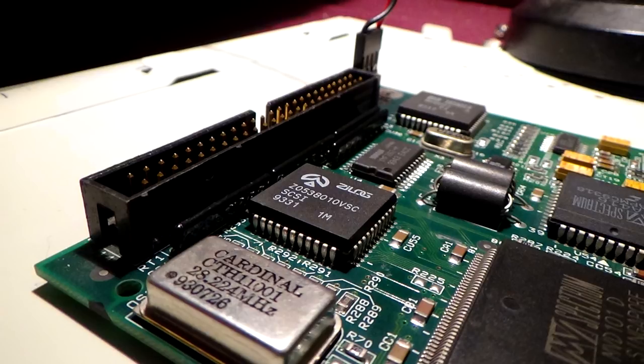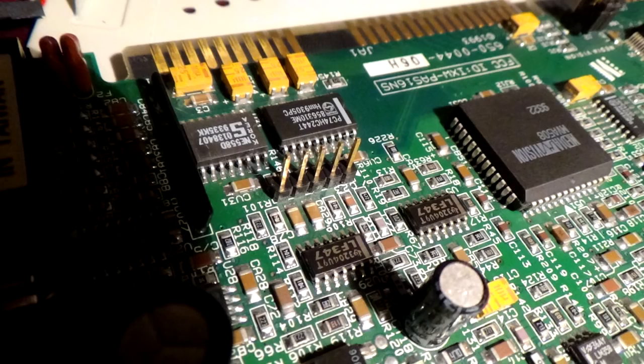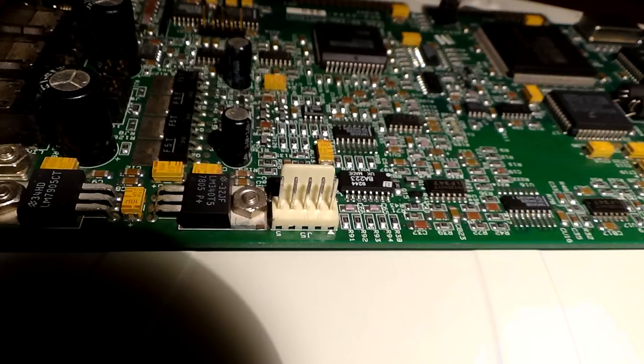One advantage to the SCSI interface is that you can actually plug in devices such as hard drives, and they'll work, you can use them, but you won't be able to boot from them as the card has no BIOS for this purpose. It just accesses the drives when the driver's started in an operating system, so you won't be using it that way, but you can certainly plug a variety of things in there. And I guess MediaVision probably made the better decision here, at least in my opinion, especially as it gives you more room to upgrade later.